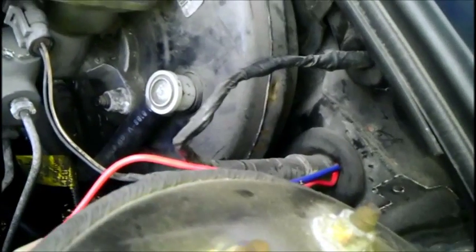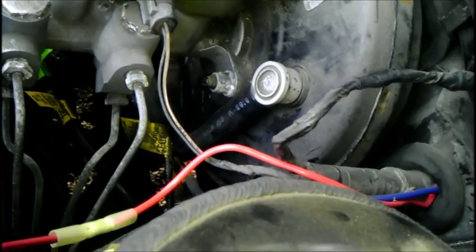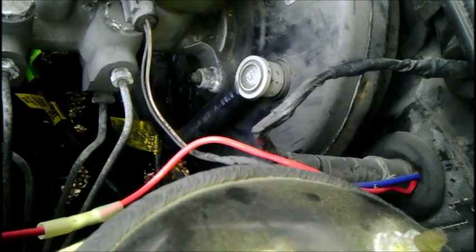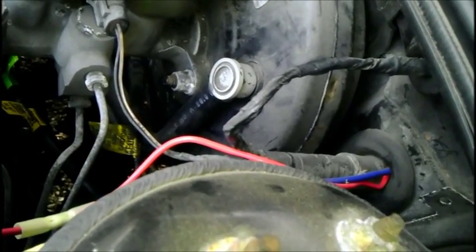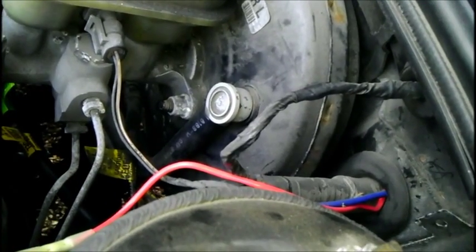Here's how to actually run the power line into your vehicle. Just so you know, this is the main wiring grommet for the vehicle. This gray conduit down here goes from this grommet all the way into your main underhood junction block. Because of that, there are important wires in this run, such as PCM wires, injector wires, ignition module wires, etc. What I would do is carefully pull back on this grommet, take a blunt-tipped Phillips-head screwdriver, carefully carve in a hole until you get one big enough to fit your wires through, and then run it into the vehicle. Just as a fair warning, do not use box cutters, knives, etc., because you do not want to nick any of these wires — you will get running problems or other electrical problems. Only use a blunt-tipped Phillips screwdriver and you'll be fine.